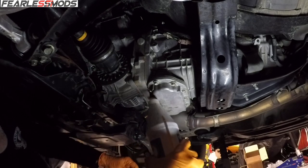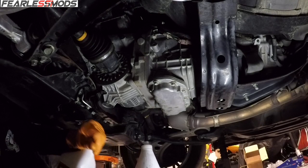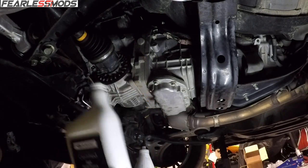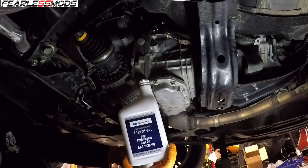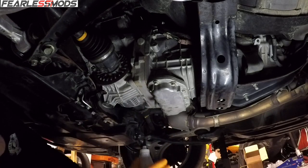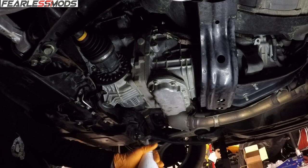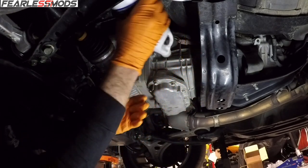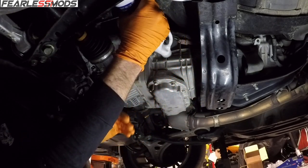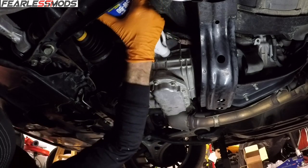What I've done is put the oil into this squeeze bottle — emptied it out and put it in there. It is not the brand you see on the bottle; it is straight from Subaru, high-performance gear oil, 75-90. That was 75-90 as well. I'm going to try to now get this up here and get the oil into the transmission — it's probably going to be a process.